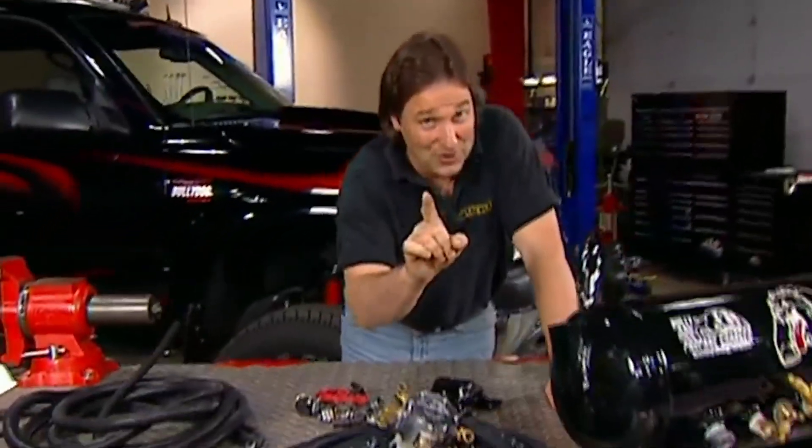That's kind of where you get into trouble, and why propane injection seems to have fallen off in the last 5, 10, 15 years. As more and more modern diesel trucks become more efficient, that 75% burn rate claim has been very hotly debated among diesel experts. We won't say it's been disproven, but it has been argued that diesels — especially modern diesels — burn much more than 75% of the fuel injected. With that in mind, propane injection has kind of fallen off. And as propane has gotten more expensive, the cost savings have dwindled. Propane burns at about a four-to-one ratio — for every four gallons of diesel, you burn one gallon of propane — which back when propane was cheap made sense, but as costs rise it gets harder to justify.